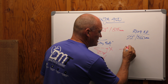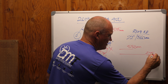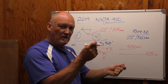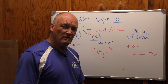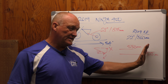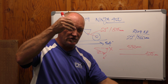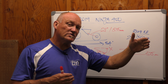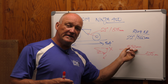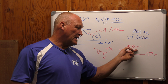Last piece: if your swing arm is short, say it's 550mm, but then you go 575mm — think of that as a breaker bar for leverage. Short bar, not a whole lot of leverage. Much longer bar, way more leverage. So if you choose to go much longer in the chassis, that's going to make it really stable but hard to turn. And with that much distance, there's a lot more leverage on the shock — so you may have to go much stronger on spring and maybe even valving because you've got more leverage. If you're shortening up the wheelbase for a tight technical track for more agility, maybe you have to go for a softer spring, and that reflects the amount of leverage you've got.